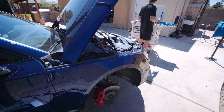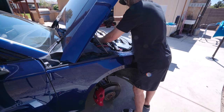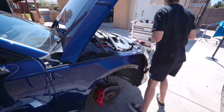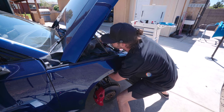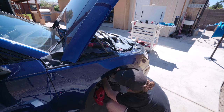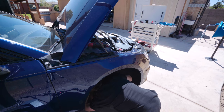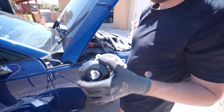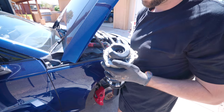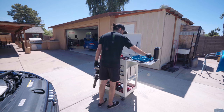Get my 13 mil handy. I'm gonna take off 2 bolts right away. Leave one in. Okay, kind of support it. Get my bolt somewhere, I'm not gonna lose it. Pop down here, see if I can wiggle this thing out. Okay, my spreader came out, so I need to open this up again. Okay, voila. Do not forget to put this plastic piece back on before you slide this back in here. Set my tools down. Put my bolt in my Bolster with the other ones.